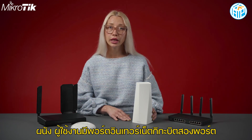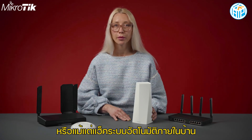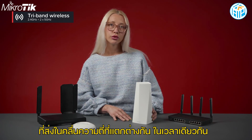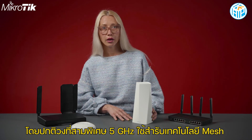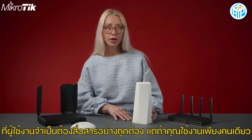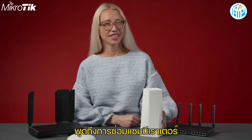Audience features 2 Gigabit Ethernet ports, so you can connect wired devices or even a home automation hub. And instead of dual-band radio, Audience is a 3-band device — it transmits in three different frequency bands at the same time. The third extra 5 GHz band is typically used for mesh technology so the Audiences can communicate with each other, but if you're using only one Audience, that third band can be used for all kinds of tinkering.